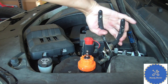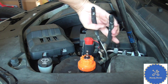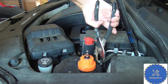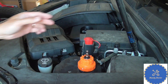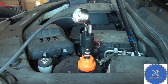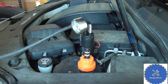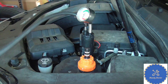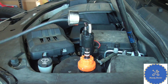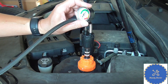Let's put the clamp back and see if that helps. I'm happy that I identified where the leak is. Now let's redo the test. Pressure up to 15 psi. If the system holds, with no leak, you should be able to reach 15 psi and it should stay at 15 psi for about 15 minutes without losing any pressure. At least I don't hear any air leak anymore, and it's reading slightly above 15 — something like 15.8 maybe.